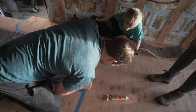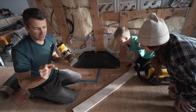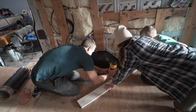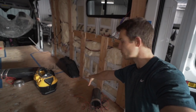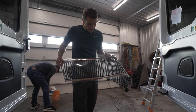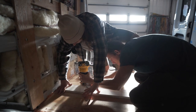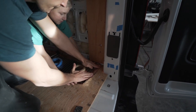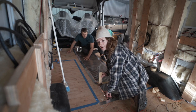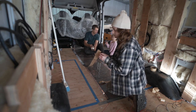We traced out the line for the wire coming out of the little notch. We're planning for the water tank and a 12 volt under-mount air conditioning unit, so we just want the heating pad on the back corner and I'm going to cut this one in half — there's a marked line showing exactly where you're allowed to cut. We're using ducting tape to secure the heating pad to the subfloor; it wrinkles really easily, so it helps to have one person pull the end of the tape to create tension while the other peels the backing a little bit at a time.